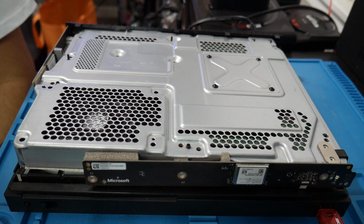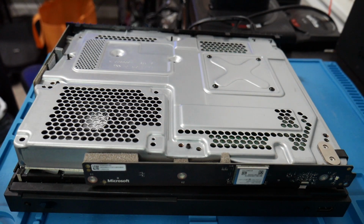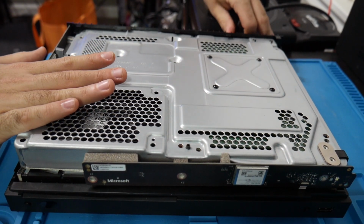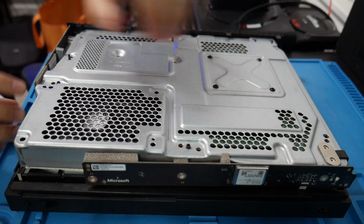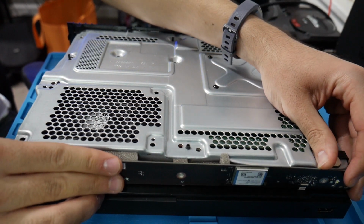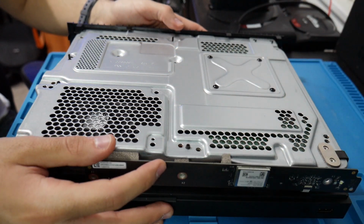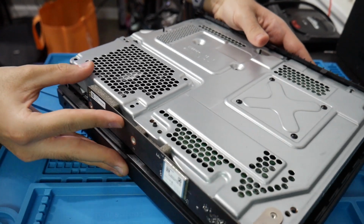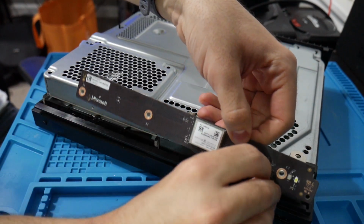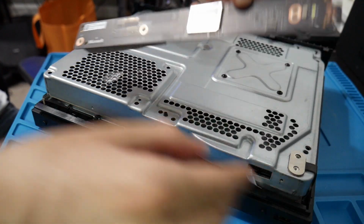All right, so Sean went through the rest of the initialization process. I'm going to unhook the flash drive and completely unplug the console, because we can confirm that it is now working beautifully with the solid state. But there is one last thing we need to do. Sean, did you notice that the cool looking Xbox One X animation did not pop up? Honestly, I didn't even think about it. It did not pop up, and we are going to fix that by putting it back on the hard drive. I don't know why, but with this process, that does not get put on there, so you have to restore it manually.